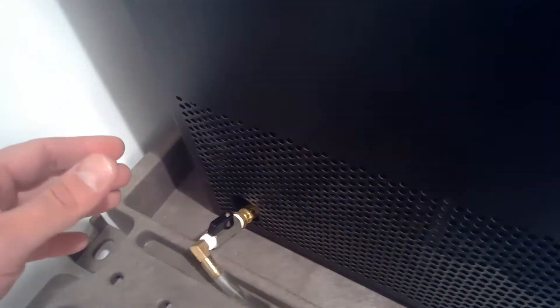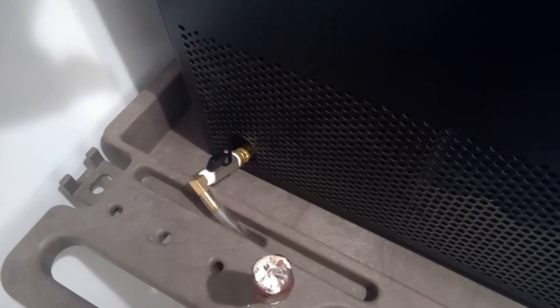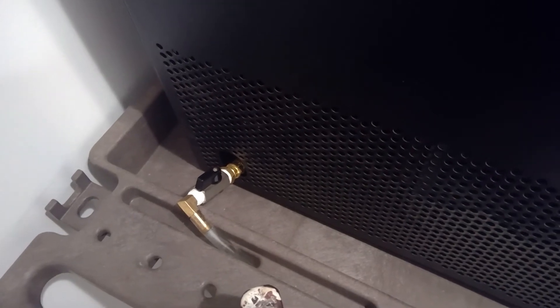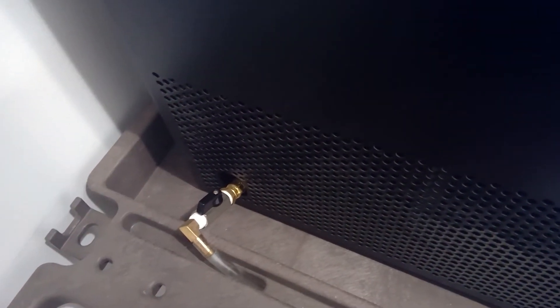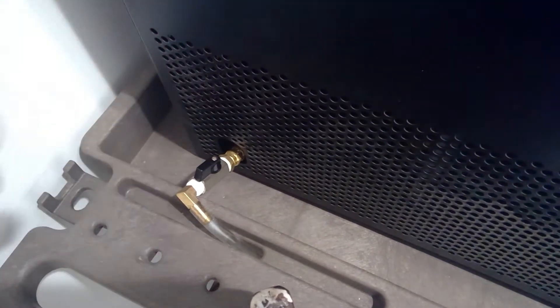At the end of your cycle you'll have to defrost the drum on the inside — you can do that manually or have the machine automatically do it. It's a lot faster to do it with the machine: the heaters will kick on and start melting that thick layer of ice that's formed around the drum. I think my machine takes about three hours, and after three hours there are still chunks of ice but you can pull them out by hand, clean it out quickly, and then put another load in. If you don't use the heater defrost mechanism, plan on a day and a half or more to thaw it out enough to pull out the ice chunks.